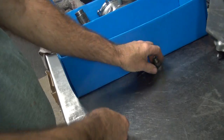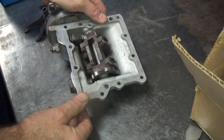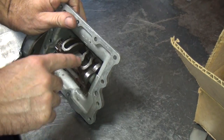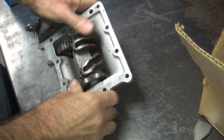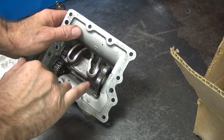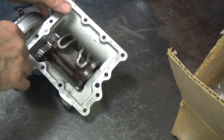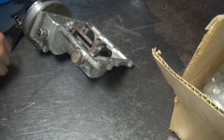I noticed we've got a lot of wear issues on this gear. You can see where somebody's been grinding on it already, and you can see how the shifter roller is digging in real heavy right here — that makes it really hard to shift.